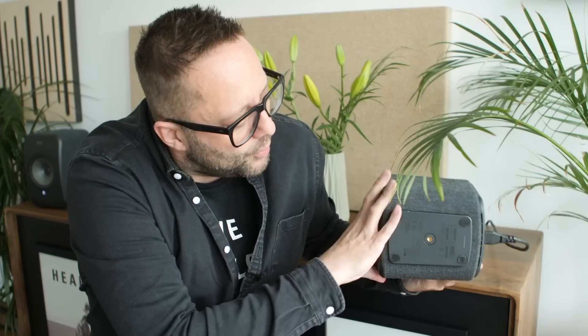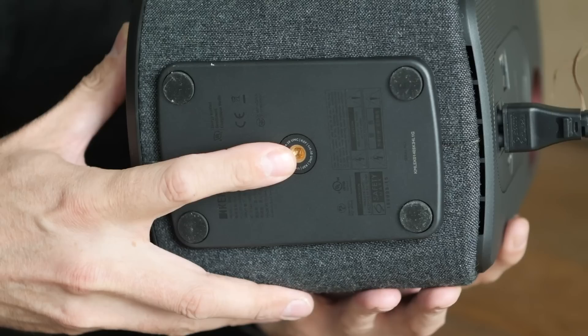These are slightly too small for my standard Atacama speaker stands, but KEF have put a screw socket for stands on the bottom — so you can use those thin stands. If you're an audiophile who thinks you'd rather be dead than use stands like that, these speakers are probably not for you. If you want to do DSD, or MQA — I don't think they're MQA enabled yet — again, not for you. If you want to do 24/192, yes these speakers can do it, but only with Ethernet and they downsample to 24/96.